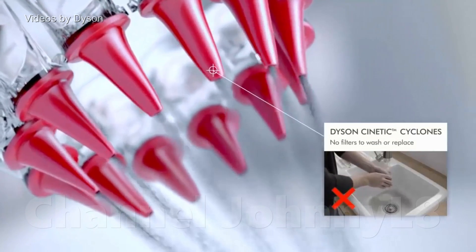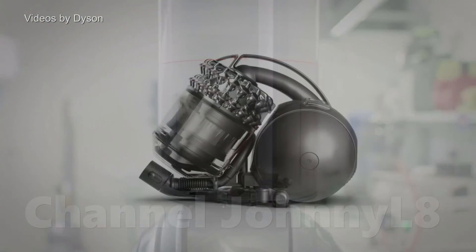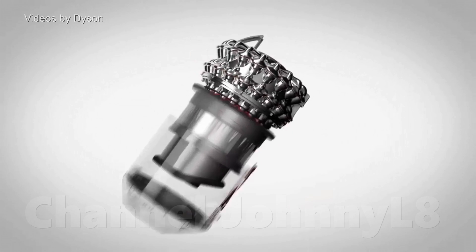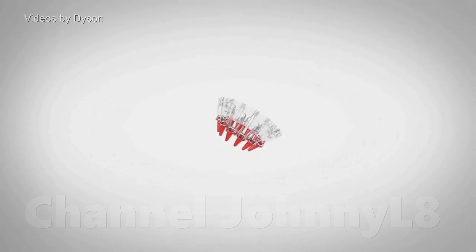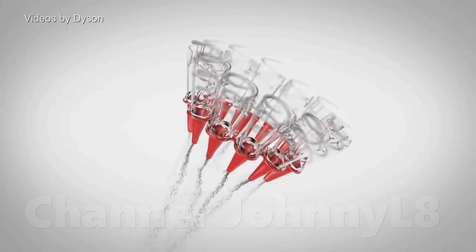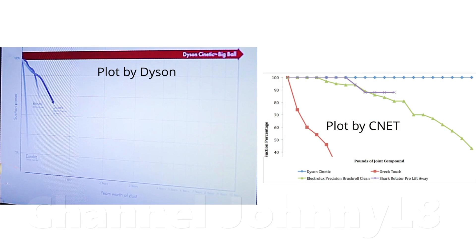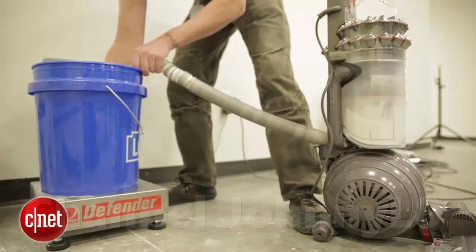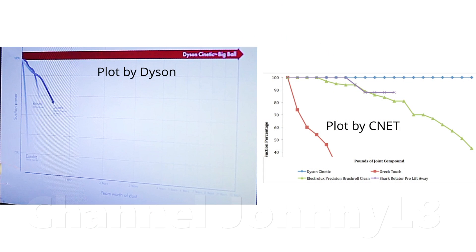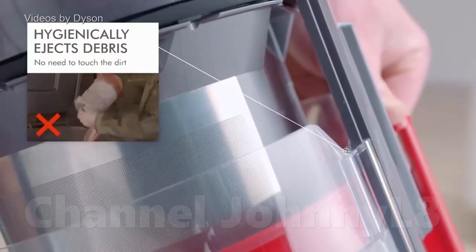It's absolutely amazing technology and a great feat of engineering. These cyclones have been rigorously tested and it's been shown that they can suck up 10 years of household fine dust without ever losing suction — 10 years being the design lifetime of the motor and other components. So little of the most ultrafine dust gets through the filtration system in 10 years of use that even the post-motor filters never need to be rinsed — they just don't clog up. This has all been thoroughly demonstrated using rigorous industry-standard testing, and others have noted this too, as you can see in plots by both Dyson and CNET. CNET actually sucked up plaster dust, which is typically forbidden in traditional cyclones. They genuinely work exactly as stated, providing airflow isn't restricted — simply empty the bin before it gets full and keep the shroud clear. That's literally all you have to do.